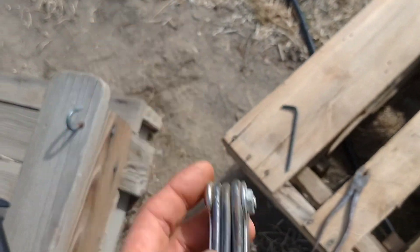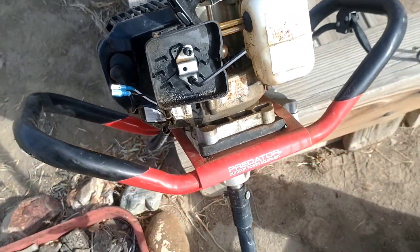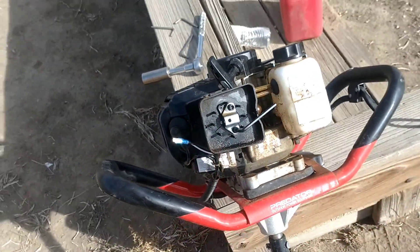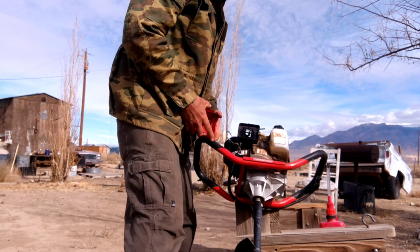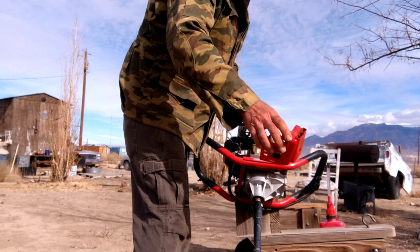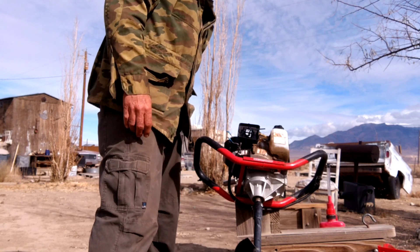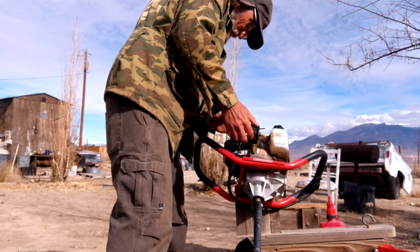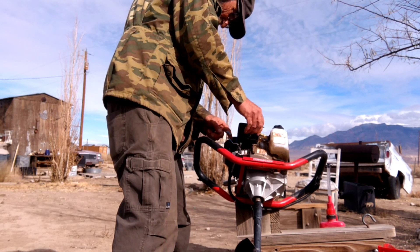These machines are a good brand but you're still dealing with Chinese-made parts, so you've got to be careful and mindful. First thing you want to do is disconnect the on/off switch from the wires. Then take the screw out of the air breather and take the breather out — this probably needs to be cleaned. Put the screw in your pocket so you don't lose it. Next, get your Allen key and unscrew the two bolts that go through the carburetor and the intake manifold.